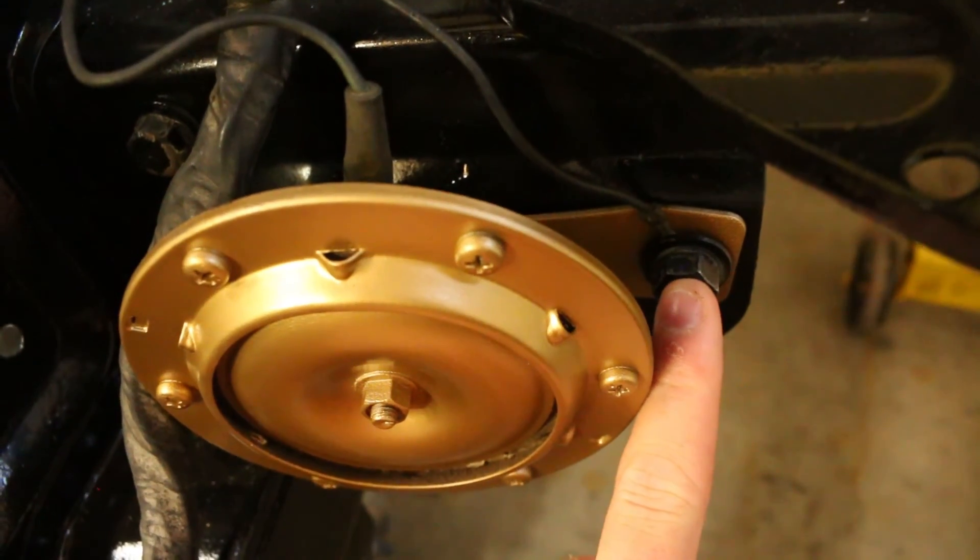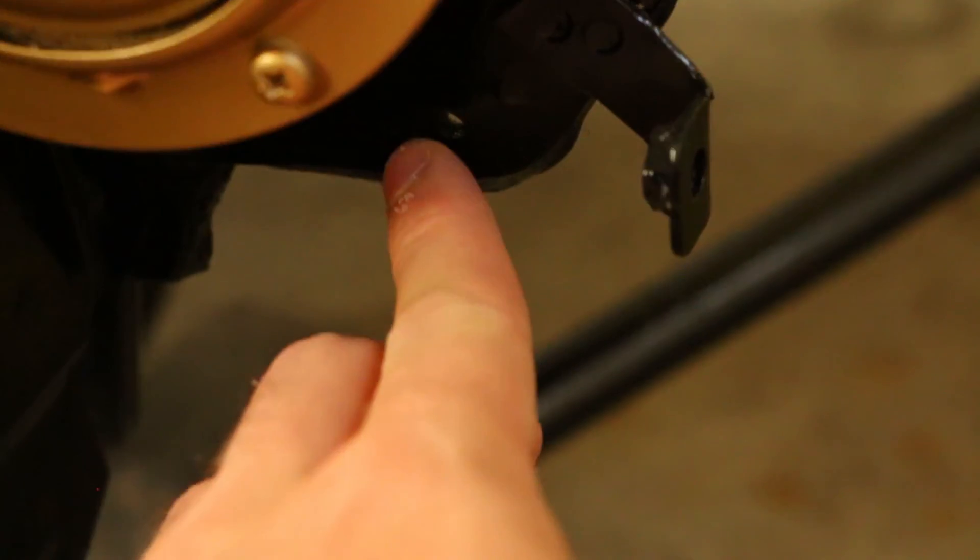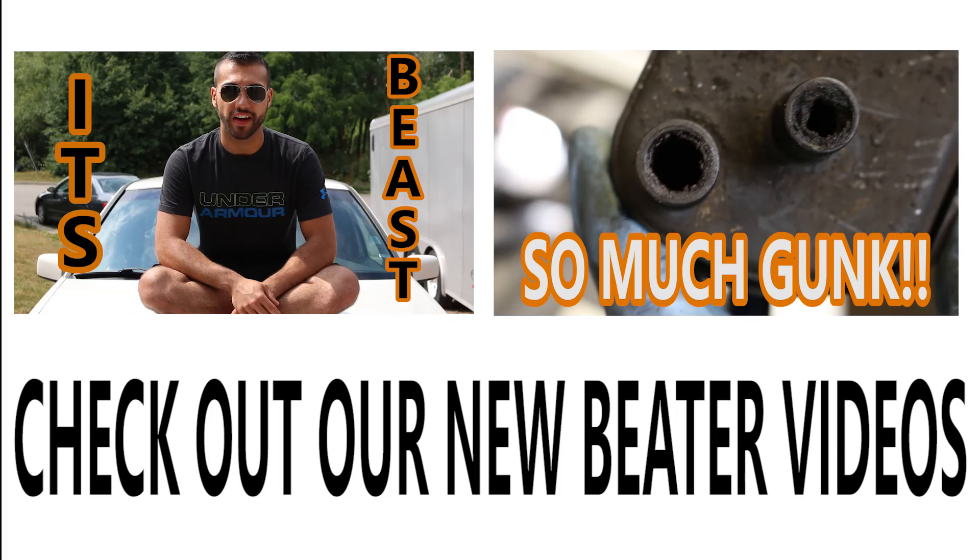All right, so the freshly painted horns are installed now. There's just one other thing I wanted to mention — if you're actually going to put a 240z bumper on a 280z, those bumper bracket bolts we used to put the horn in are probably going to be used for the 240z bumper bracket. This isn't an issue — you can use the same bolt and the same hole, you'll just have to run it through the horn hole we made first, then through the bracket hole and bolt it into the same spot. If you don't want to do that, you can also extend the wires on the horn and run it to the bottom bracket hole that's already there for the bumper. That's it for this video, hope you guys liked it and are going to do this on your car — stay classy crew!